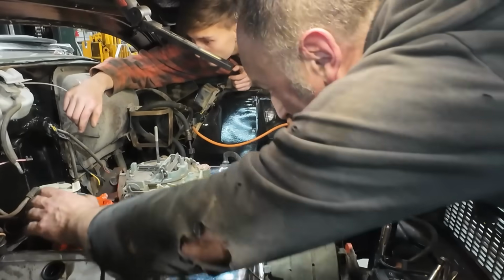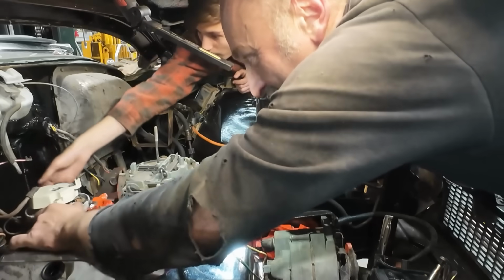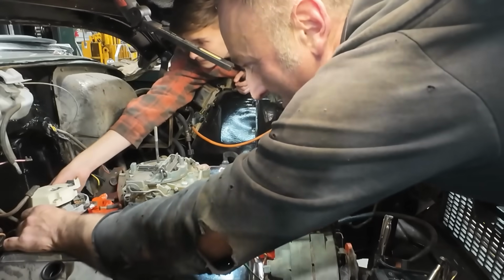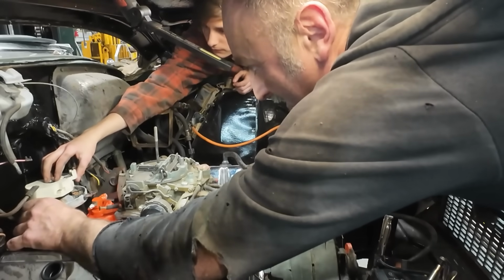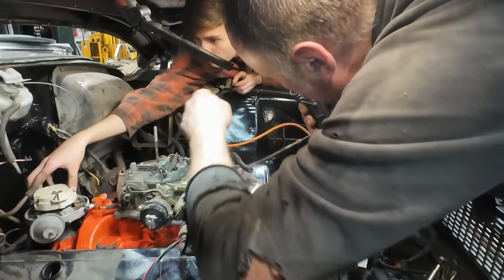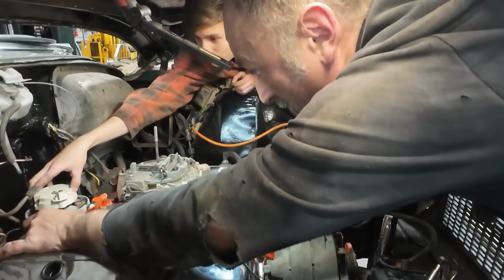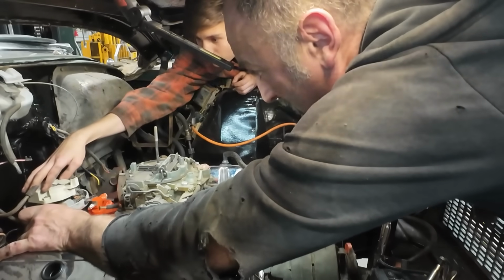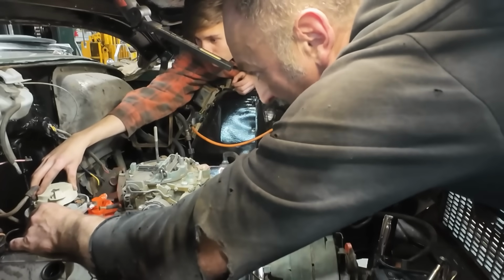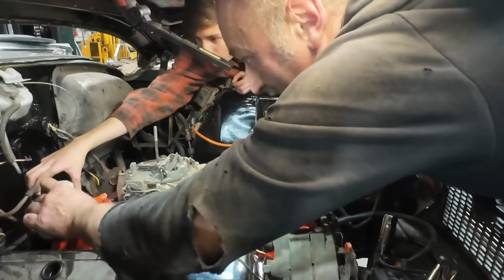See how it doesn't wanna go down? So that means this thing always turns a slightest little bit. Well, I think it's going on something right here, so it's not going down. Yeah, nope, still not. We're gonna go up, feel this thing. You'll see what I mean. I'll give it a little bit of a turn, half a turn. All right, I went down. This is the sucky part. I want this to point to that one. Otherwise, this becomes your number one plug. We're gonna lift up and move just a tooth. We gotta hop this thing all the way around. So now turn it my way, just a tooth. You basically have to keep bumping this thing till it goes all the way around. So then we go up again. Get a little greedy, go back a bit.